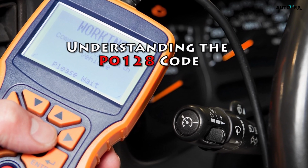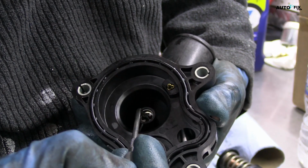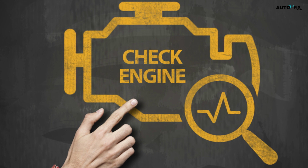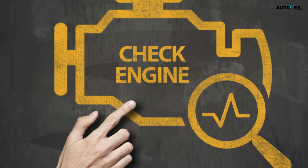Understanding the P0128 code. The P0128 code is an indication of a stuck-open thermostat, which results in the coolant temperature being below the expected level. When your Jeep Grand Cherokee's engine computer detects this, it triggers the check engine light. Understanding the root cause of the code is the first step in resolving the issue.